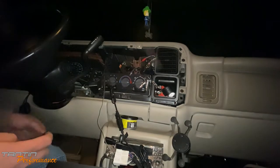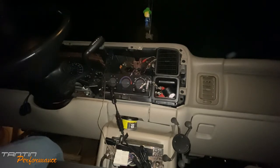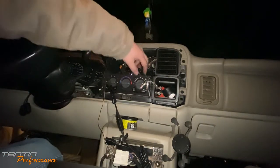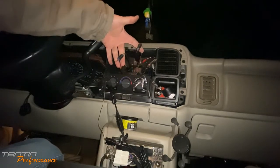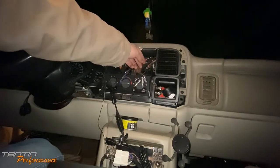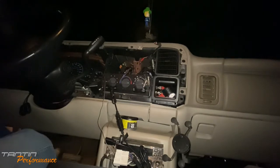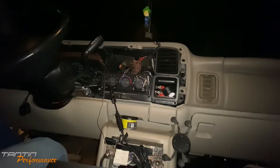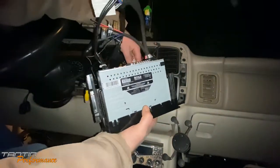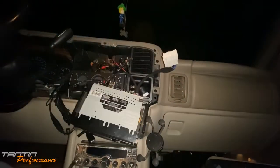One of my old videos of putting a backup camera in the '02 Silverado shows how to get that backup source as well. I went back to the amps to take a better picture of my RCA hookups. The sub is mono so it doesn't matter how it connects to the head unit, but to get fade correct I do have to hook up front and rear correctly or they'll be backwards. I don't want to have to modify the amp rack since it's all nice and tidy.